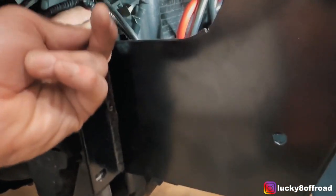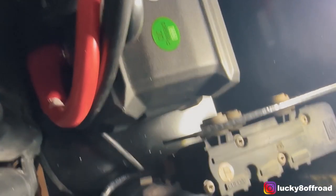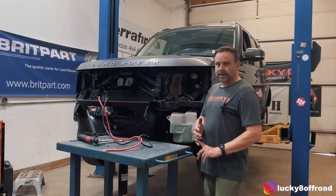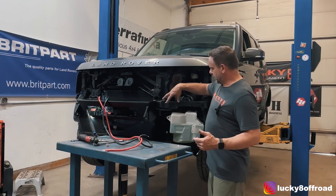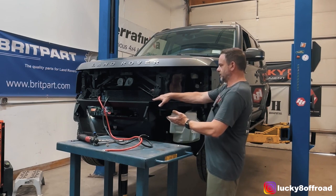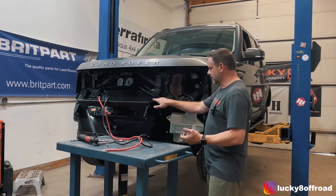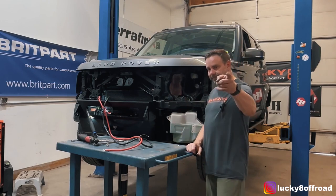The lines are moved out of the way, I put a bolt back in to hold up the winch, and the bracket is installed — protected from all the elements. Now put all of the bolts in. Depending on how you cut this piece, leave a little bit. You're going to want to make sure the top of the winch is resting on the upper radiator support. Use your cart to get it in place, get all the bolts in, and tighten them up.